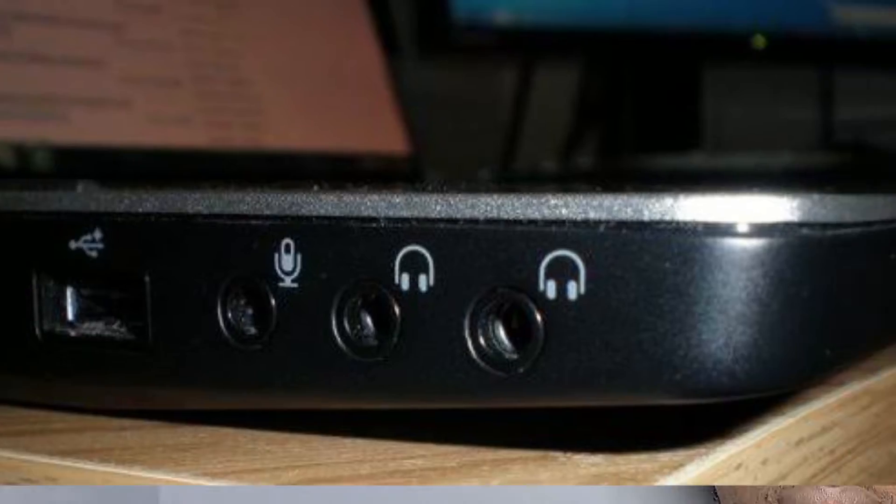I'm going to show you how to connect a microphone like this and also directly from the mixer. But first of all, if your system does not have two ports where you can connect an earpiece and microphone, you need to have a sound card. The sound card lets you bring in sound from outside to your system, because your system's sound port is actually to send sound outside — that's why when you wear earphones you hear the sound from the laptop.